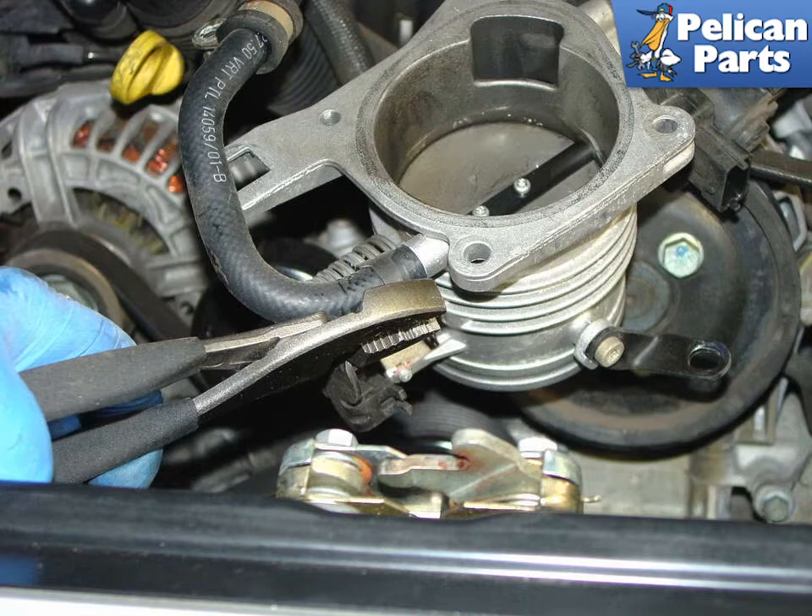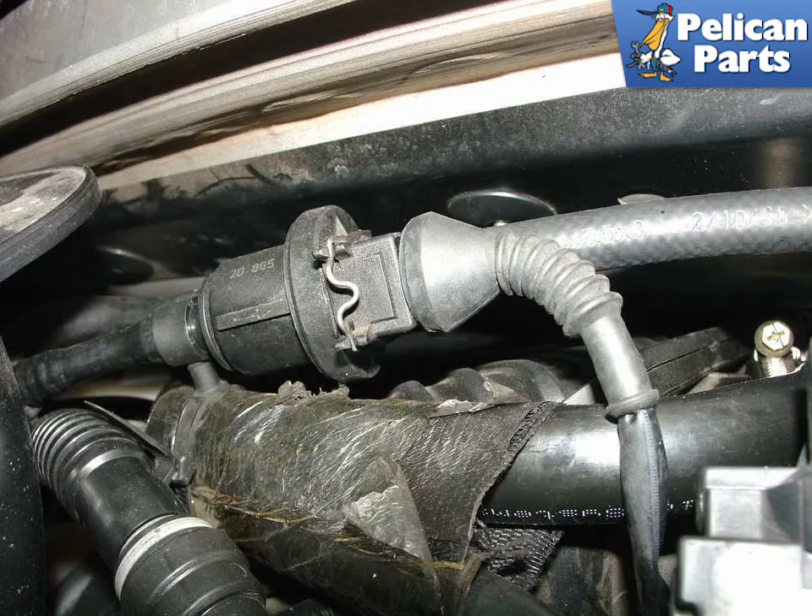Don't forget to pull the O-ring out of the intake plenum that seals the throttle body to it. Again on the older cars only, follow the hose connection coming off of the throttle back to the control solenoid and press the wire piece in to release the electrical connector. Now place the hose solenoid assembly off to the side.